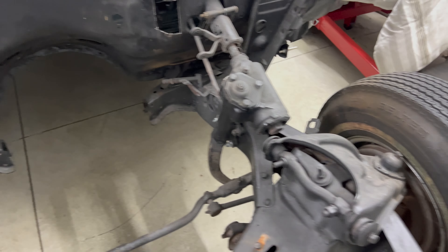Got those wheels and tires swapped out. As far as how far they're sticking out, it's just about perfect in my personal opinion. Now this is a super short tire, which is why there's a big amount of wheel gap. We are going to run a little bit taller tire. And then if there's still too much room, you got to take into account how much suspension travel there's going to be under load — you don't want things sitting too low and be hitting your quarters on the tires, especially when you accelerate. We are going to be running ball joint spacers up front, and with the size of tire — the cheater slick that we have on the steelies — I think this ride height will be perfect. But don't judge us on the height of these tires cause they are not even close to what we'll be running, just gives us an idea of wheel offset, width, backspacing, and all that to get on the steel wheels to fit this five-inch bolt pattern.